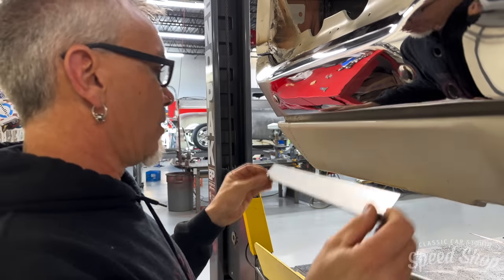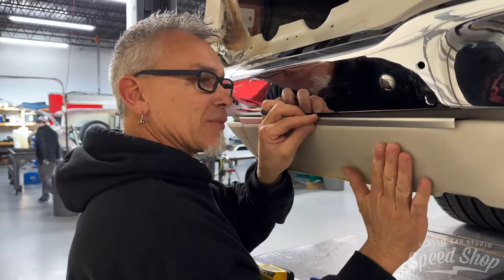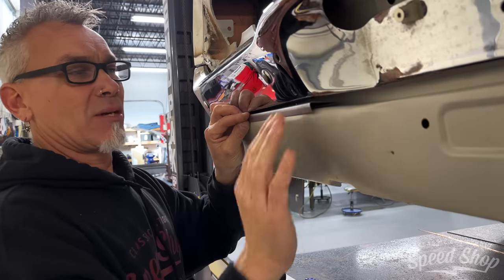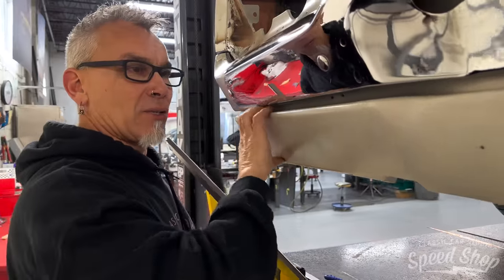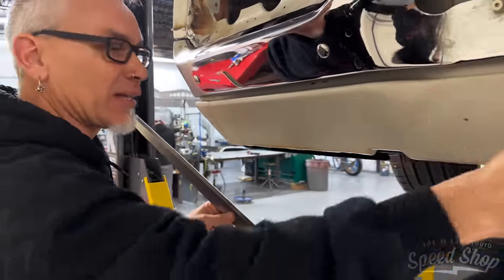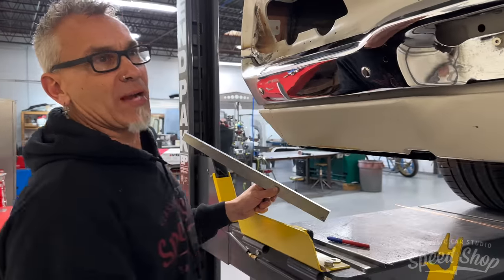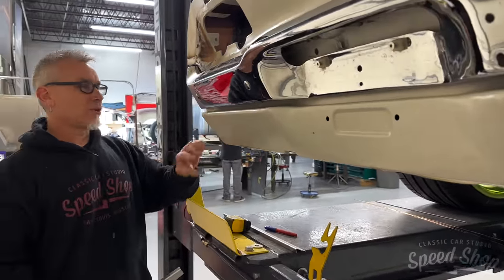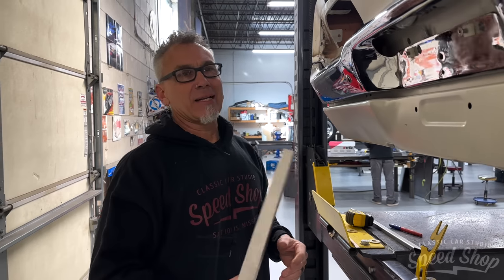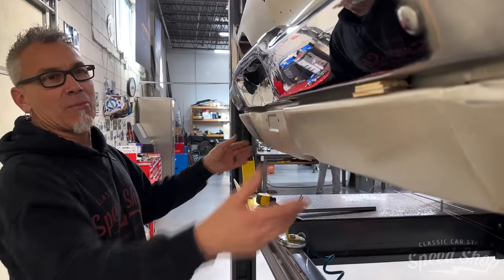I was going to make a little piece that would go in there and raise up my bumper cap. I don't like the way this is coming out and then it goes in and then the bumper is still going — got too many funky things. I want this panel to float with the bumper straight down. So by the time I remassage this panel, take this out and that out and make it fit the bottom of the car better than what factory had, it's more the right thing to do just to get rid of the whole panel and build one from scratch. Need a little taller and a little more angle, and we got some damage in this corner. So by remaking the whole panel, we'll get everything that we want — a better fit, the corner remade where there's some damage. At the end of the day, we got a better piece for a flush mount bumper on a custom built car. You can't have a custom built car with factory panels, so we make all the panels custom too.